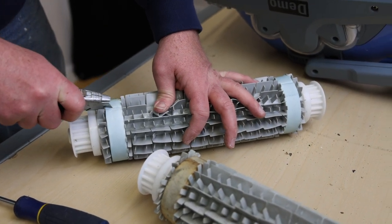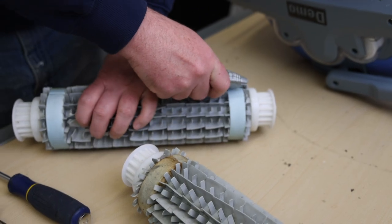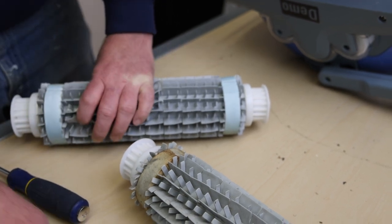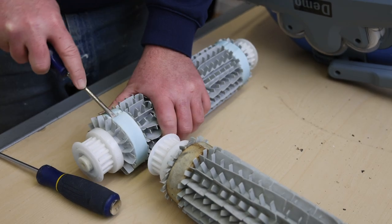To remove the older rings, take a knife or box cutter and cut across each one. You don't have to cut all the way through — then take your flathead screwdriver at the same location that you cut and gently twist all the way across, prying under it and slowly breaking through the foam. It should make an audible snapping noise when it completely breaks, at which point you can remove it from the roller.